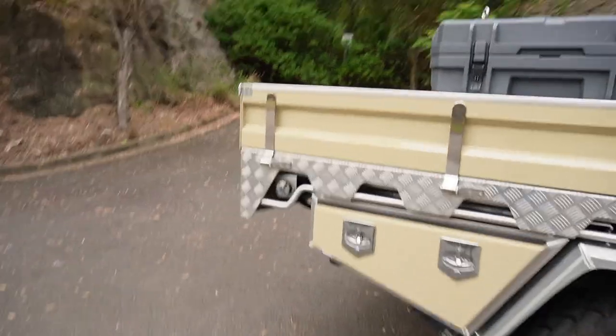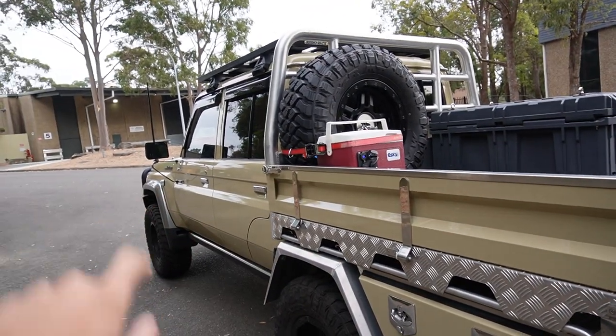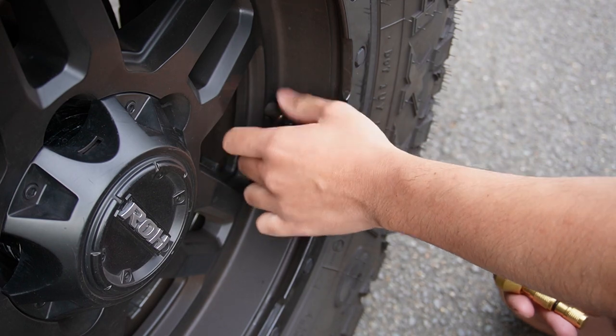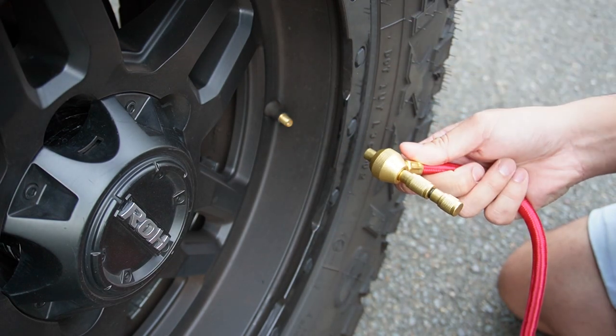The whole installation is complete and I'm really happy with how it's turned out. For the wiring, I ended up running it down the passenger side of the vehicle — straight across the tow bar and then along with the brake lines all the way down to the engine bay. That was the most straightforward and neatest way, keeping all the electrical components like the relay and circuit breakers on the passenger side of the engine bay. The compressor is mounted inside the toolbox and I've also got all this area I want to keep organized — I thought about putting the ARB organizer in here, let me know what you guys think.